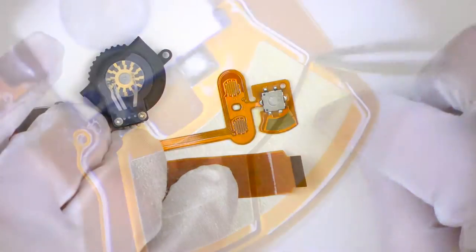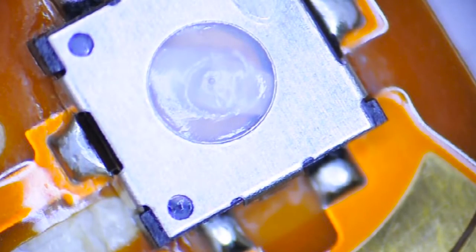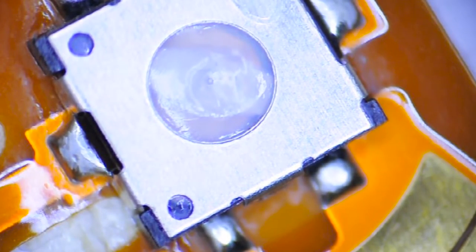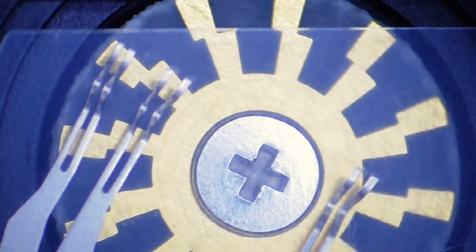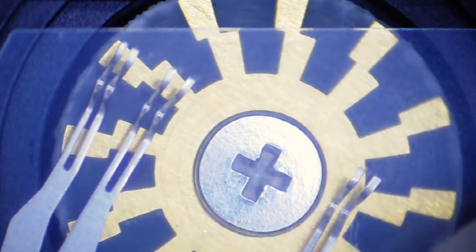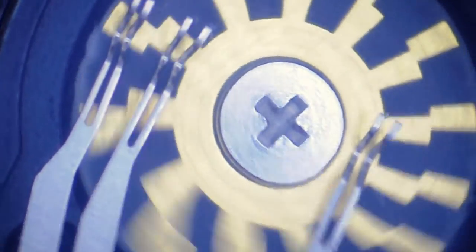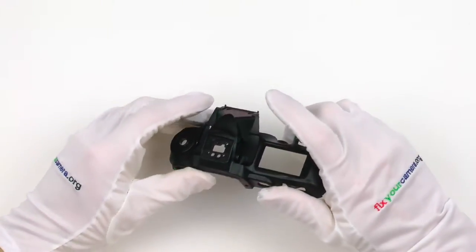Power switch contacts very often require some cleaning. The shutter release switch very often requires replacement — these microswitches overall don't last too long, which is why you won't find them in professional cameras. The dial is a very typical rotary encoder design with phase-shifted traces so the main microcontroller can detect the direction you're turning. If this encoder starts to behave erratically or doesn't register every single click, it's usually just cleaning that's needed. Any cracks in this plastic part will qualify it for replacement, and that happens quite often unfortunately.